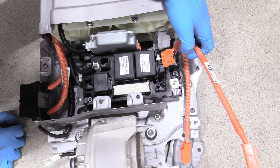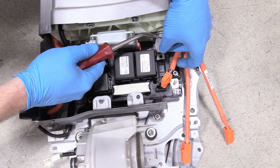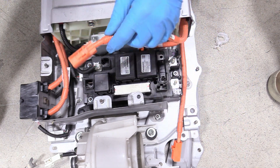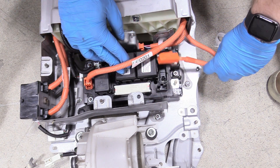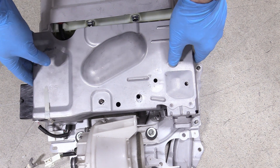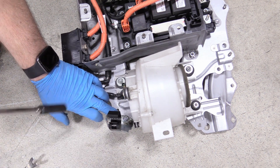What we need to do is plug all three of these guys in — I'm going to start with the more challenging one. It goes like this into this silver module here. We can plug these connectors in — this one goes over here, and don't worry, you can't get these wrong. Toyota made that idiot-proof, which I appreciate. This is our cover plate for the whole thing, but you really can't install it until it is in the car, so don't worry about that. I'm going to put this bracket back on — honestly I don't even think you need this bracket; all it does is hold a piece of the wiring harness.